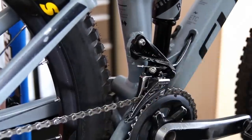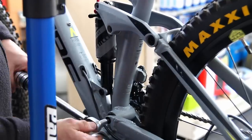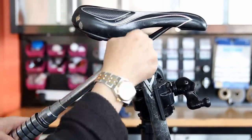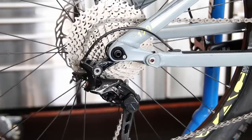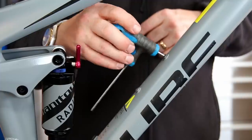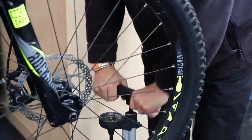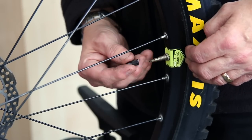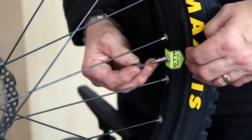A couple of the pivots were actually loose - when you torque those up it's all the things that, when servicing a bike, just tighten it all up and make it feel like new again: fewer rattles, less movement, just tightens everything up nicely. That's why we go through everything with the torque wrench. Even these old bottle cage bolts that weren't being used were loose and droning in the frame - just pinching those up stops some of that noise.